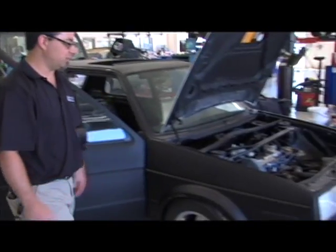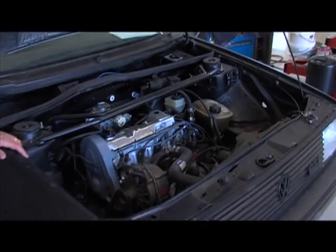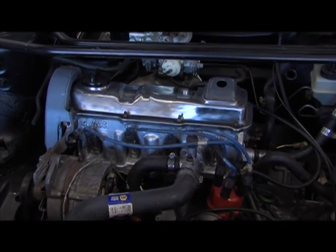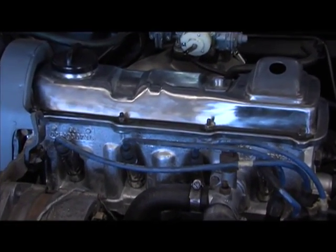All right, so here's another project. Now this one seems new to a lot of people because maybe you haven't seen it recently, but this car's actually been with us for a couple of years. It was another car that was donated to us. It's got a pretty cool history, we understand. It used to be a road race car, and we're working to make it into an autocross car. So if you zoom in here on the engine, we've done some work here. Again, another example, we had an engine. This engine was hurt, had broken ringlands in it, so we had some compression problems, a ton of blow-by.